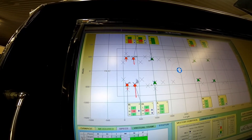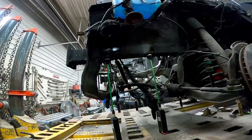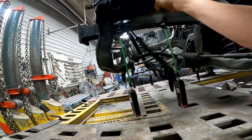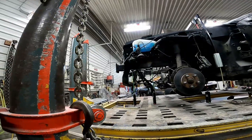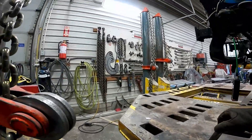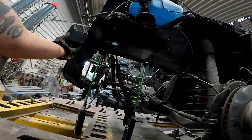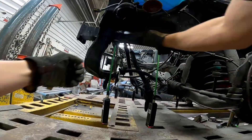As you can see, my rails are both over this way — the middle of the rail worse than the tips. That means someone's already tried to pull the tips of the rail over and didn't get enough of the rail pulled. I'm going to try and straighten that out so the rails aren't bowed and get them back in the green. I want to pull this section of the rail — the whole front has to go that way, but this area here has to go over more than the front.